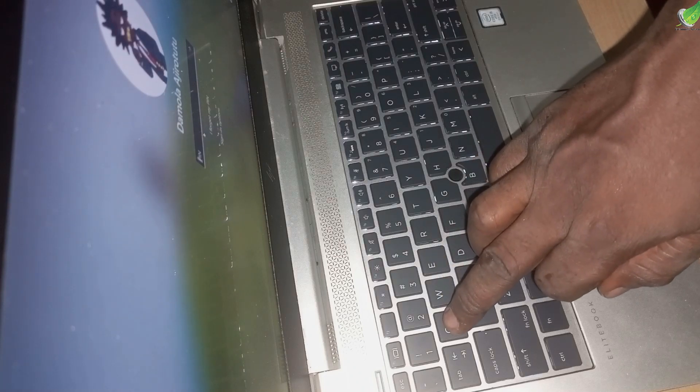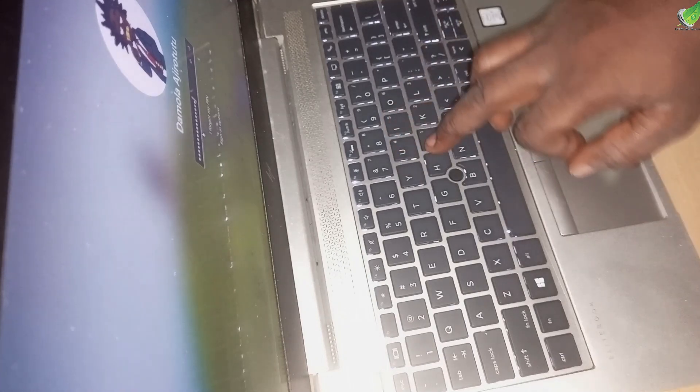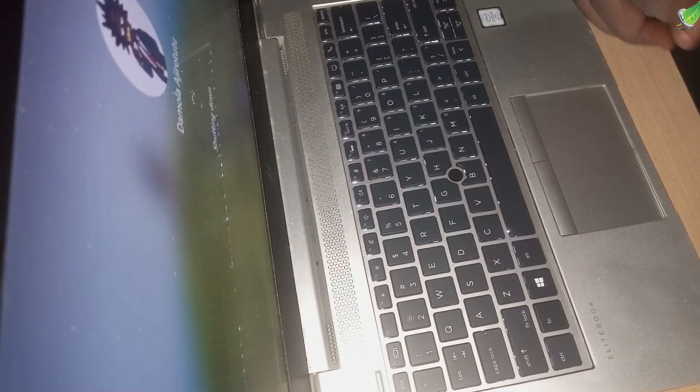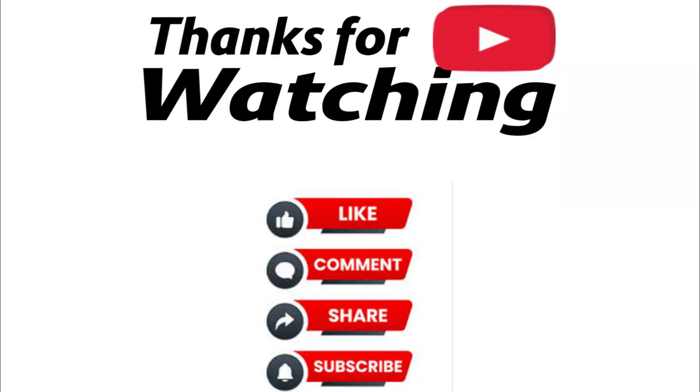Let's see if the keyboard works — I'm going to type in a couple of keys. All of the keys are working. If you're fixing your own keyboard and notice that some keys are not responding, go back, open up the keyboard flex area, remove the flex, and fix it back in properly — it's probably not well seated. If this video was helpful, remember to share. Thank you for watching, I'll see you in the next one.